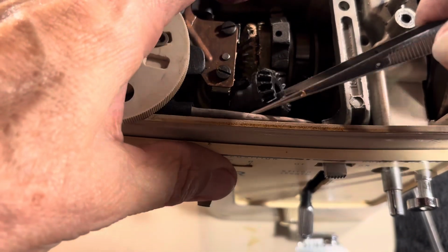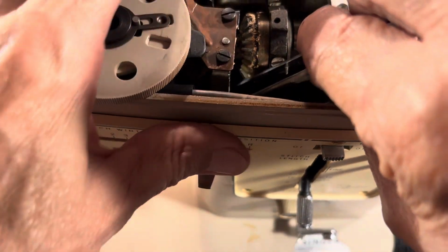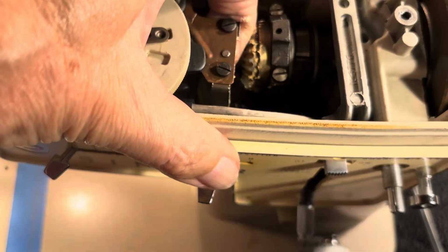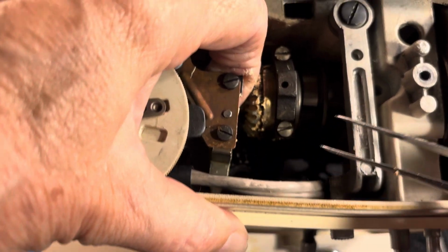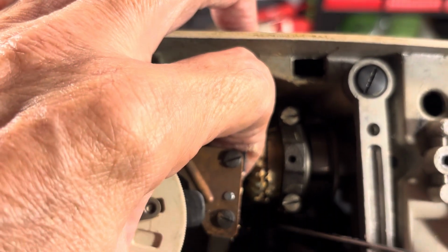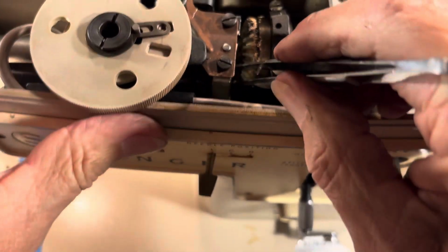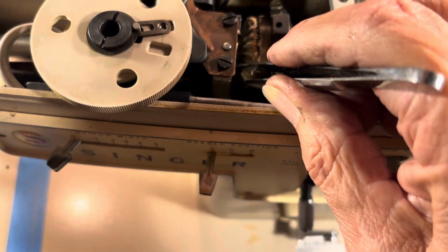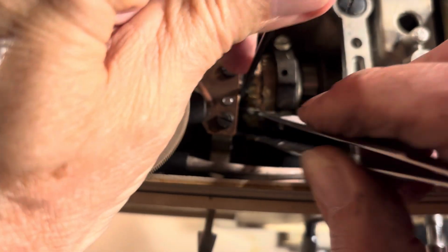And someone, of course, greased the heck out of this thing, which is crazy because the grease probably contributed to the gear falling apart, because when you grease them, of course, it breaks down that part that the gear is made of. It'll absolutely melt it. It doesn't help to grease plastic gears. They run dry. They run dry as a bone. And I'm gonna stick this down through there to hold that gear in place so it doesn't go sliding along.